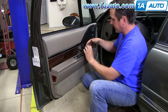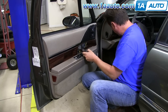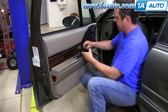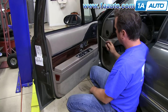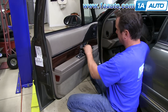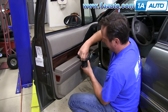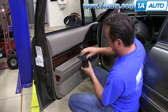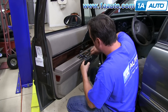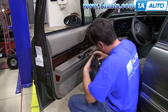At the same time, I'm going to disconnect the unlock lock switch by using a pocket screwdriver and popping up on the tab on the side. Then I'll pry on the front edge of the switch pack and pull it forward and out. There are a bunch of connectors — some have tabs, some just hold together by friction. We're using the small screwdriver to either push the tabs in or pry the connector up and off.